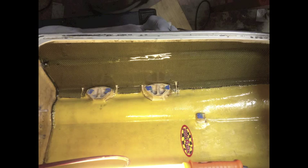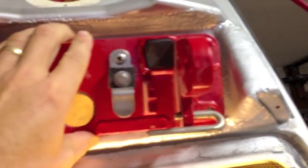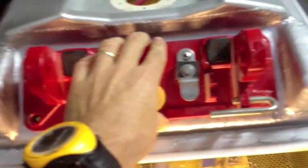Here's the Kevlar carbon weave on the sides. You can see it came out fairly well. You can get a little bit of perspective about how it lays over the epoxy I poured into the bond line. Make sure you scuff up that epoxy before you start putting this in. You can also see that I came down onto the floor a little bit and had to cut around the remainder of the ribs. Take your time doing this — it can be challenging but hopefully it'll all be worth it. I sanded that area down nice and flat so that this sits real flat and there's no rocking, and then painted it.